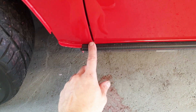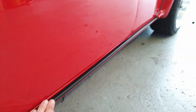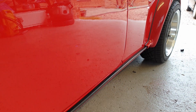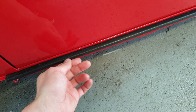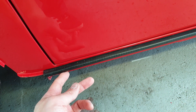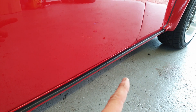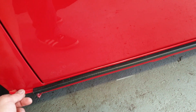Once that's done I'll be putting the wheel arch back on. I've also been working on the bottom — I took the finishing strip off and cleaned it up because there was a lot of gunk in there. For those of you who remember the IMM mud fiasco, I'd still got some in there. As I was cleaning with the blue roll I noticed there was rust underneath where it had been spot welded. I ground it all off back to bare metal and treated it with Cure Rust, leaving it for about 12 hours so it was fully in, then repainted it with spare red paint.